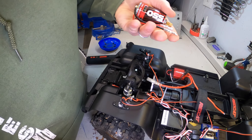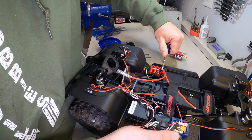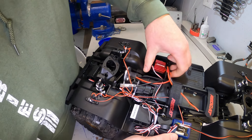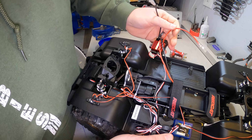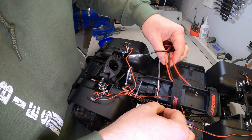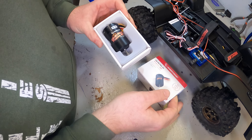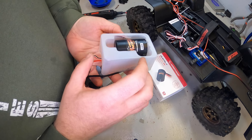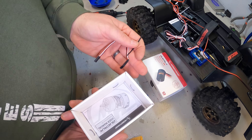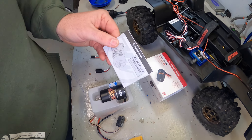Unplug the two motor wires here — the motor is now completely free. Then all we have to do is take a flat blade screwdriver to pry with and get right underneath the ESC. It is just held on with some double-sided tape. The only thing left is to unplug the ESC wire from the receiver extension. With that done, we're going to hop this Fusion SE out of the box. Inside you'll find the motor itself with the power switch and battery cables, an extension lead, and the manual, which we'll need because there will be some tuning to do.